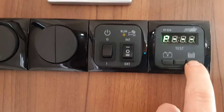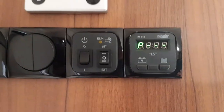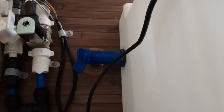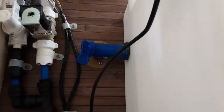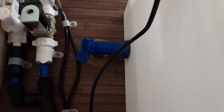There's a level indicator that tells you how much water you have in the onboard water tank. Once the hot water tank in the front is full, you can also fill the tank at the back of the caravan. On the left-hand side of that rear tank you'll see a blue valve — when the blue valve is in its current position it allows you to fill the tank. If it's turned over so the ball part points towards the outside of the caravan, it will drain the tank down completely.